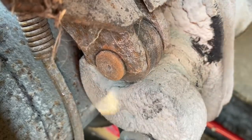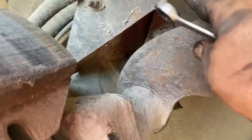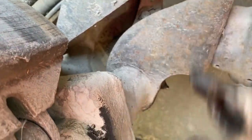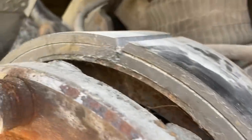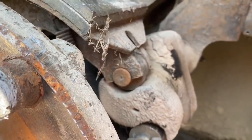You can tell by how dirty it is that there's no twist or turn. We just did it, it moved it. The actual slack adjuster moved a quarter inch or something. That was it. These brakes look brand new, so maybe they got worked on and it never worked.